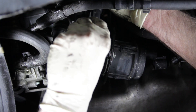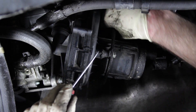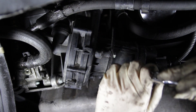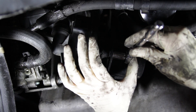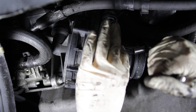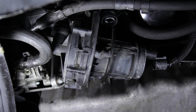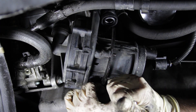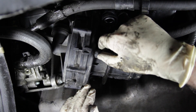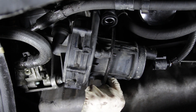These hoses can be pretty challenging, so sometimes you might want to try to get them worked off and then start your removal of your 10mm. One other note: this pump has mounts that mount the pump to this mounting bracket and they do get pretty worn. We don't have any new ones here to show you, so we're going to be reusing these. As you can see, they have small cracks in them, so this might be something you'd consider replacing at that time, because eventually they can break if they're starting to crack.